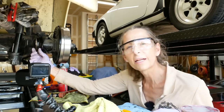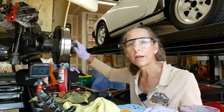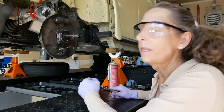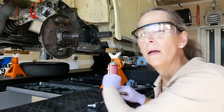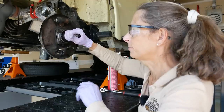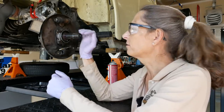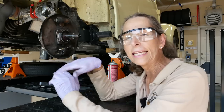Our flange is quite a bit closer now and feels where it should be. As I run the nut in, it just absolutely stopped — which is exactly what I'd expect. I couldn't find a torque spec for these bolts, so just nip them up — tight but don't go crazy. Remember how it was when we started — that clicky clicky? No movement at all now. A wheel bearing really shouldn't have any play in it — in or out, up or down. I think we did a good job on our bearings.